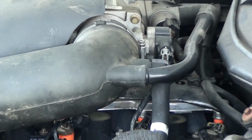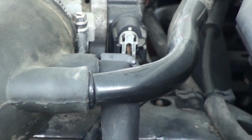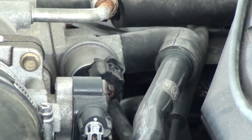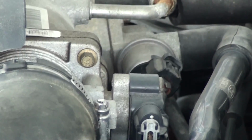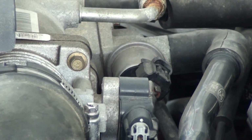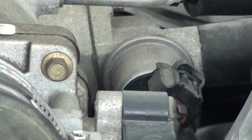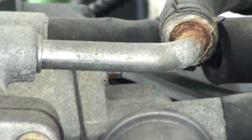It sits, if you look right here at your air intake tube. You got two tubes that come into it right there, right? See the big one, closest one toward us? Follow it. See it going back over there? See what it hooks to. See that little solenoid right there? You got a plug with a solenoid on it. It's the one behind, not the front one. The first one's your throttle position sensor. But it's right there. You got to unplug it.